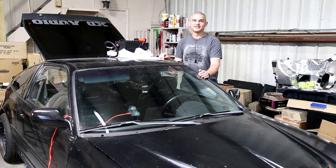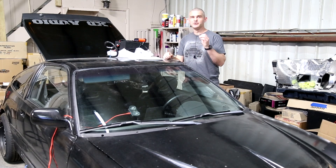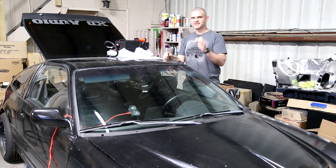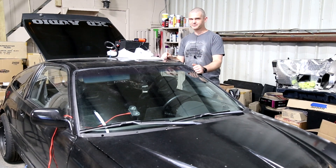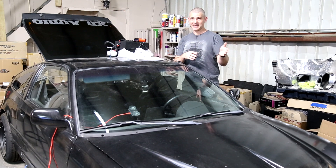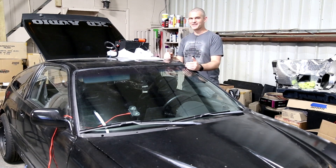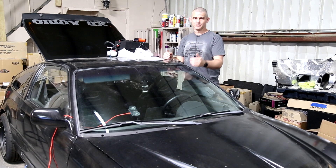This is a CRX, so it's automatically going to be loud. We've seen the setup and the car. What we're going to do is go to 2,000 watts, which we'll keep a monitor on with SPL, and compare so every burp is right at the same power — it might be a few watts off, but that shouldn't make any difference at the 2,000-watt level. We're going to do this 10 to 20 times, write down the data, see how the score changes, look at how impedance changes, and log all of that data to see what happens over time as the other sub gets broken in.